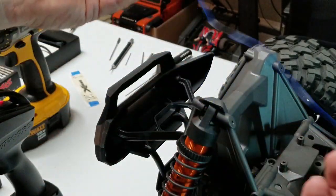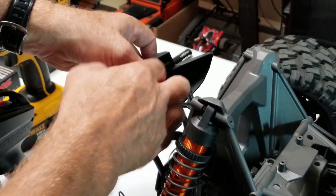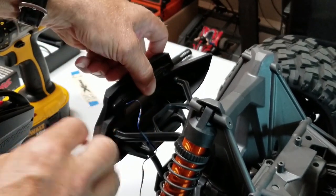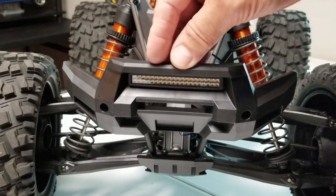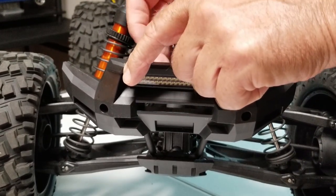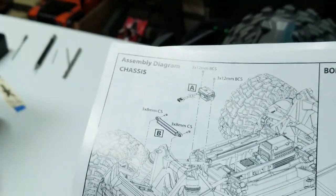This light bar with a single wire goes in this opening in the bumper with the wire on the left side of the truck. It also has these little pockets that fit over bosses, which locates it nicely. This looks well protected, tucked inside the bumper. I'm going to run these wires through here and wire tie this neatly to the frame. This front bar will mount with these 8mm socket head cap screws.